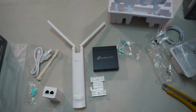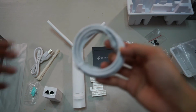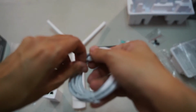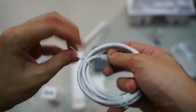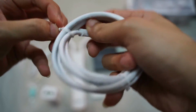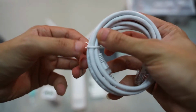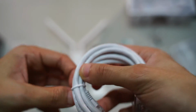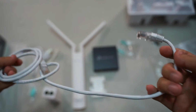What we liked about this system is that inside the OC200 app, which you can access web-based or just through your phone, you can actually see the signal strength of each of those wireless network units. But it's still preferred that you connect it over wire by using this Cat5e or Cat6 standard cable, because it omits the problem of wireless interference and connectivity issues.